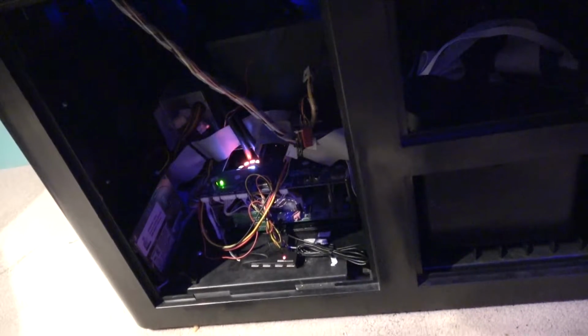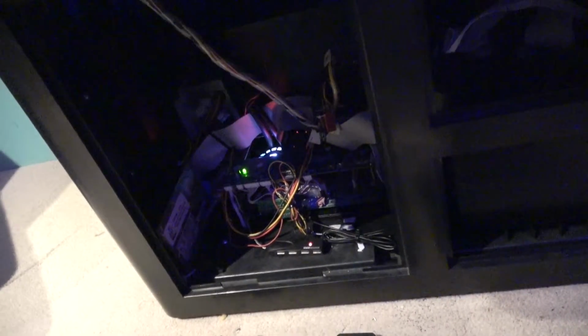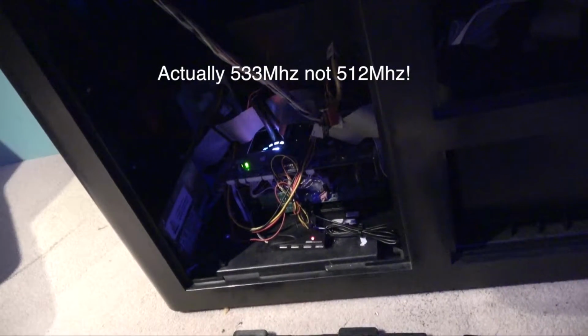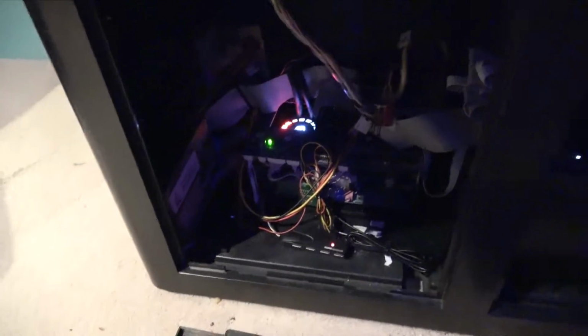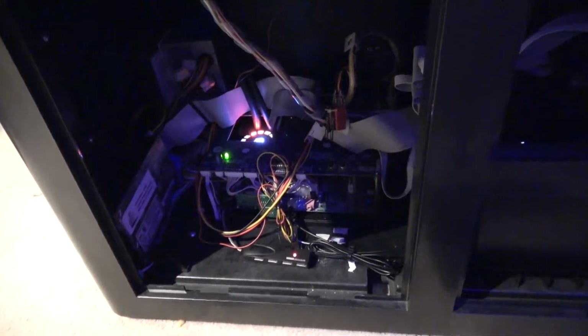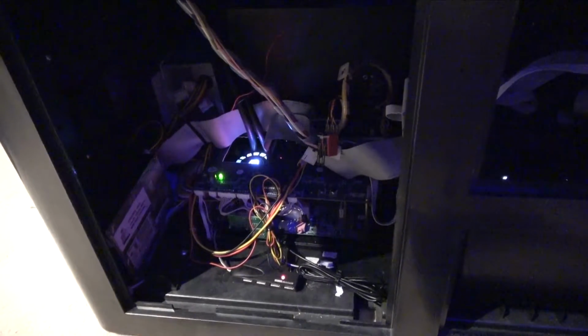The original chip is 400 megahertz front side bus, and I know some people got confused thinking that maybe it was the only one it supports, but it does support the higher 533 megahertz front side bus on the P4 2.4, and I think up to 2.8. Certainly works on the 2.4, that's what I've got in here. And the cooling on top was absolutely necessary because it was just too damn loud. The standard Pentium 4 fan is just a shocker. It sounded like a jet in here, and that was made worse because at the back of the cab there was a really cheap, horrible fan for the whole case, and I ended up removing that. It's not needed in there. And the other fan now on top of the processor is pushing the air around, and that seems to be good enough. So a few little mods there to improve the performance.